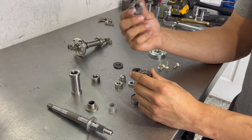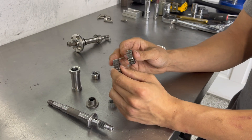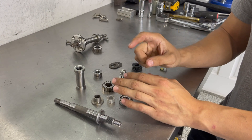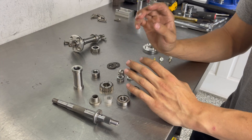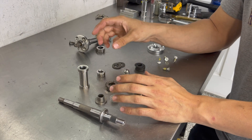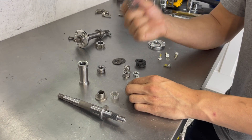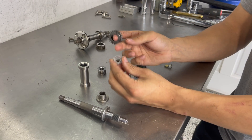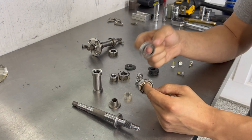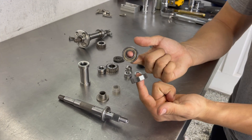We already saw that this gear broke the teeth off. In extreme cases I've seen the entire gear just disappear — completely shatters, fragments, and it's all throughout your engine. The bad part with any of these things failing is not only do you run the risk of your supercharger being completely destroyed and having to buy a replacement, which is far more expensive than rebuilding it, but you will also have to pull the engine out of the ski, take it apart, and thoroughly clean it to get any fragmented pieces out. If your gear breaks you'll have pieces circulating through the engine, you'll have needle bearings scattered throughout. If your clutch washers fail you'll have fragmented pieces all throughout the engine. A bearing failure typically won't scatter pieces through the engine — it will get stopped in the supercharger — but it will absolutely wipe out your supercharger.